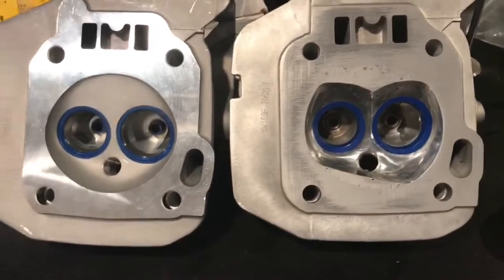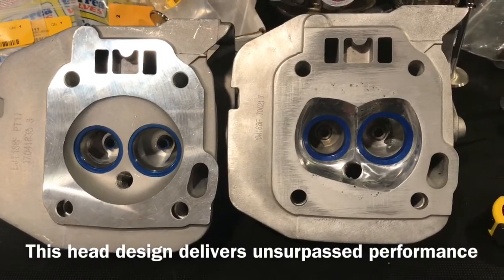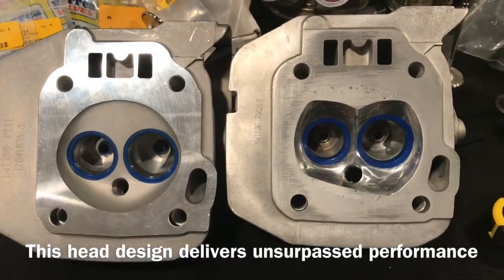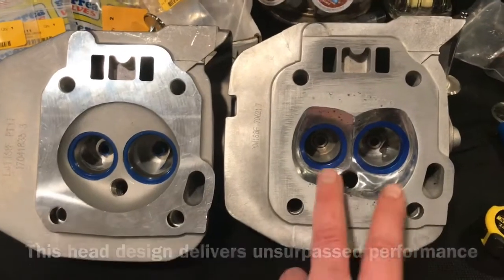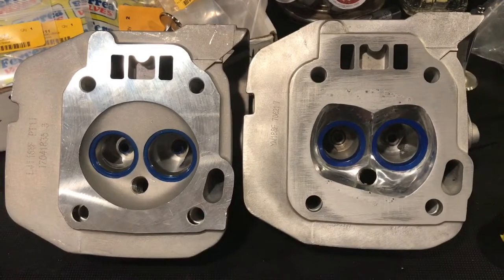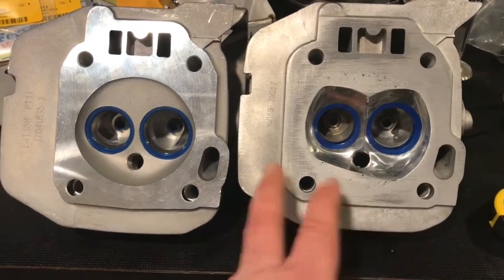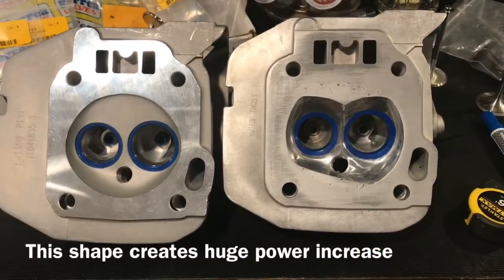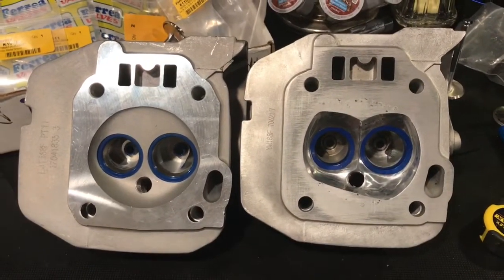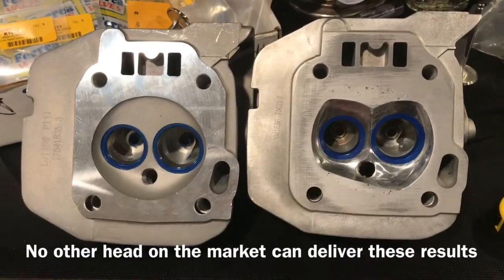This is just to improve the flow. This shape through the testing that I do here at my house — I have a box that I can test the flow on and I can flow it through the exact size cylinder that we have on these engines. This cylinder shape is the final shape that all my research has pointed towards as the optimum design. There are a couple of measurements that are very specific to this; it does involve the placement of the seats in the cylinder head and really specific angles on the floor.